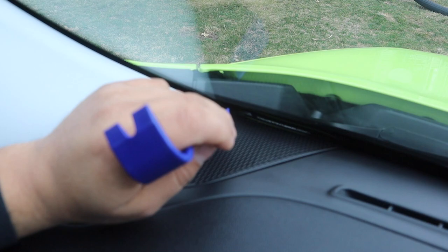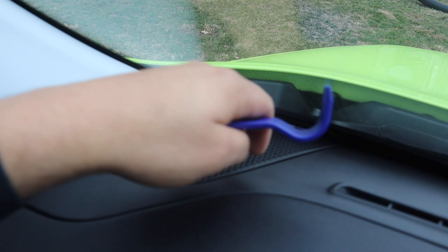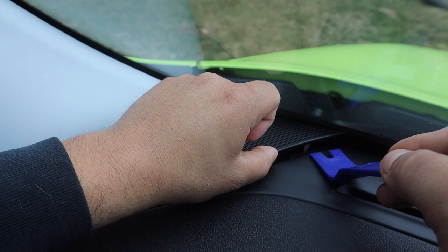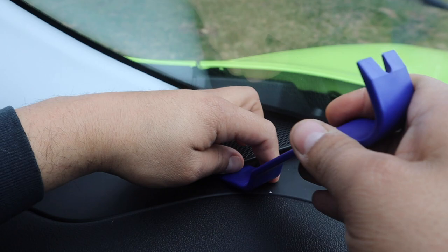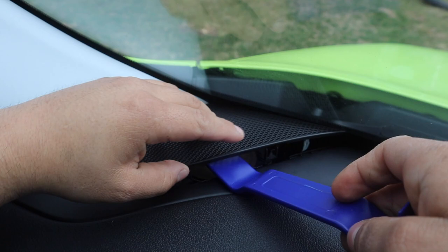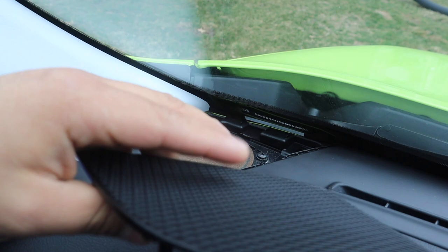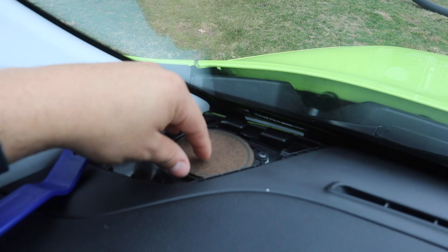This might be a little tougher to film than I imagined, but I think we're gonna make it work. This actually comes out very easy as long as you get your panel removing tool. I kind of want to wedge it down there — wedge it in there trying to pop it off. There are a couple pop tabs — there should be I think three or four. I'll keep sliding over as we go. There we go, pop tabs off — and that's the speaker right here by the looks of it.